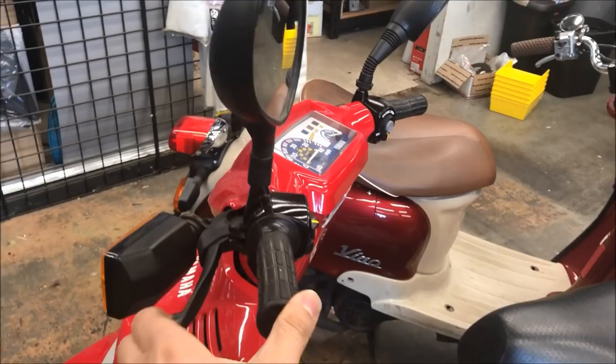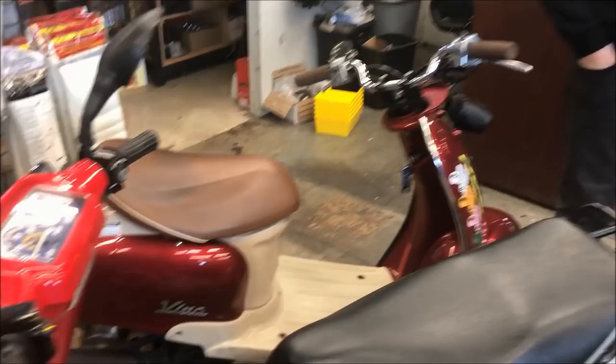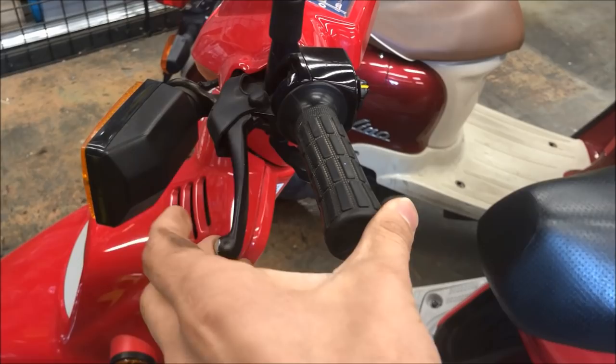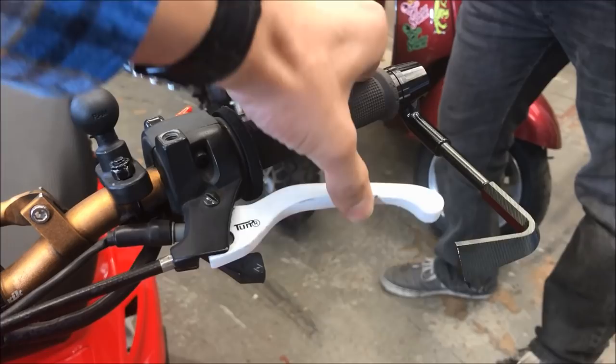And one thing to mention, I've always noticed, is having your brake set up properly. Older cables are going to be more squishy, right? So it doesn't really spring back. You want to have really, really good feel in that brake. Yep, the better you can get your rear brake, as far as lubing up your cable, having better levers. If you have bad feeling in your rear brakes, it's not going to get your brakes right when you hit them. You're going to have to go through that spongy feeling.